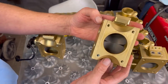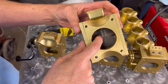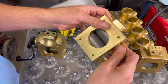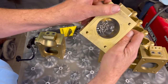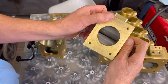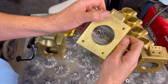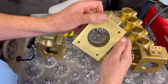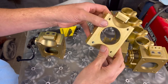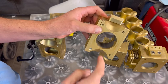So now you can see it a little bit better. If I show you the close-up of this — you can see this is the back side — as it turns and opens up, you have that free-flowing airflow. There's a stop, so it stops and closes off the throttle body or the airflow, and then opens up to a nice gradual flow. And then wide open, it's completely open — no restriction at all.